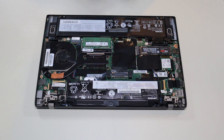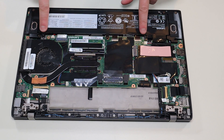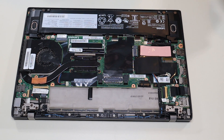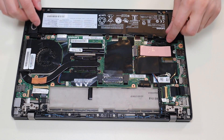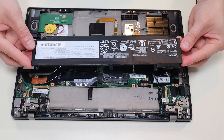Before doing anything in a computer, I always either remove or at least unplug the battery. It makes it safer to work on when as little power as possible is running through the computer. In this computer we have two batteries. The main computer battery screws in there and there, and plugs into the motherboard right here underneath this tape. I'm going to take out those screws and it's held down underneath these two clips, so I'll pop it up out of that port and slide it out from under those two clips.